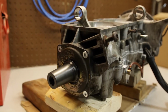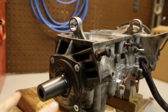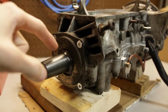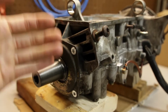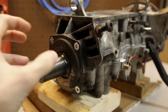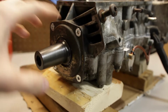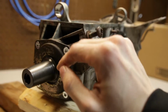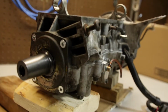So of course we got the PTO side, the bearings in there that needs Isoflex grease. So I greased that and I made sure I got lots in there. The manual calls for, when you assemble it, to put some between the bearing and the seal. I actually forgot to do that. So I made sure I squished a lot in behind, and a lot went in, so I'm very confident that bearing is totally greased, but I'm probably going to have to grease that bearing again before it would necessarily need it, you know what I mean? So I'm probably going to grease it again soon, just to make sure that there's lots of grease in there.